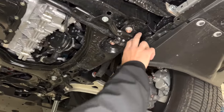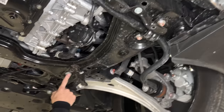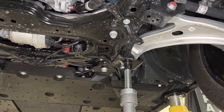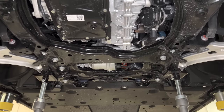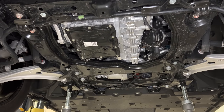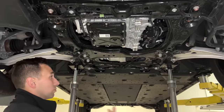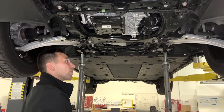These are stabilizer bar links. They've got an isolated mount right here. And then they actually transfer to hard mounts as they go aft. So it looks to be an isolated front end. Obviously, we haven't de-decked the whole assembly, but they have an isolated front end, but then they have a hard-mounted rear, which is an interesting choice. There's reasons why you would do that. Not super clear in this application why they did it.